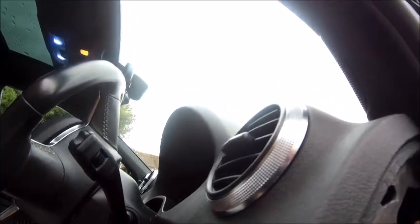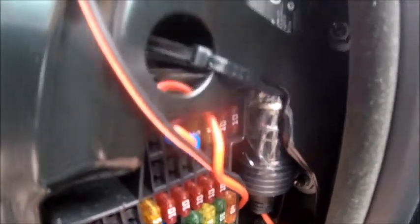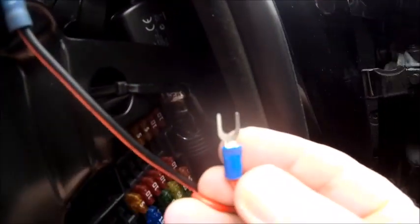Not going to do it now because it's been hardwired for ages, but on the Audi you've got a fuse box just here. All you need to do is get yourself one of these little cigarette lighter adapters — just tucked up there. A lot of these dash cams are not 12 volts, they are 5 or 6 volt, so you get yourself one of these cigarette lighter adapters and just splice that in. Tape in your connector, earth it out with a good earth, then find yourself a live connector — put a spade connector on the end.